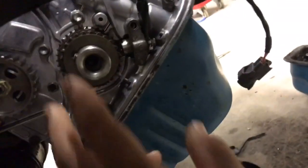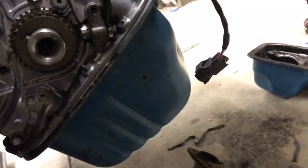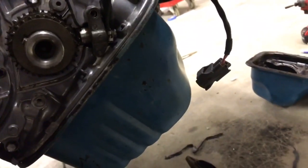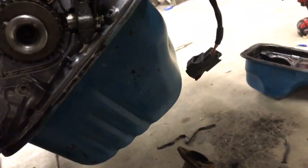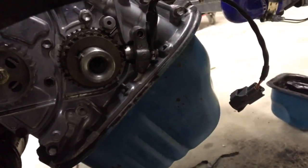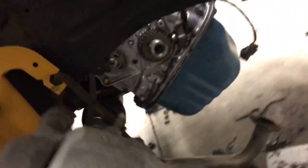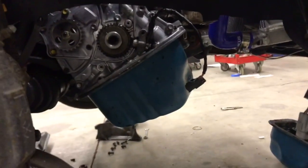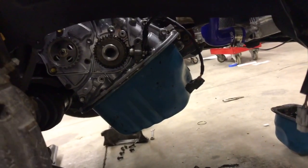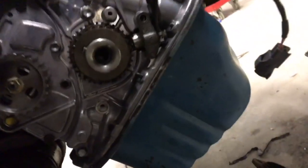In this case I am actually using this for crankshaft only, and that's going to be enough information for semi-sequential fuel injection and waste spark. However I'm going to keep the distributor, so I'm going to have the coil driving the spark and then the distributor will distribute that. All I need is this crankshaft position sensor down here and we're good. So anybody who's building a 5S turbo, this is a great little thing to do. It's all parts you can get from the junkyard — I got all this stuff from the junkyard, then I bought the pump new just because I didn't want that from the junkyard.